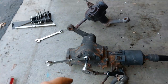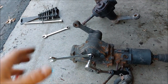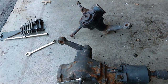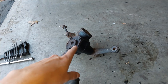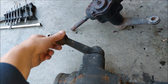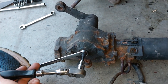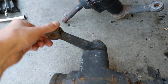Next, get in your truck and go for a drive to see what it feels like. If the slop got better, you're moving in the right direction. If the steering got really tight, especially when you're at center, that probably means the gearbox is worn out and you won't be able to adjust it. If there's still slightly more slop, come back, loosen the lock nut, go another 180 degrees, lock it, and check again. See — the slop is gone.